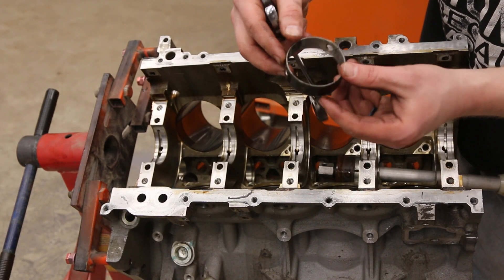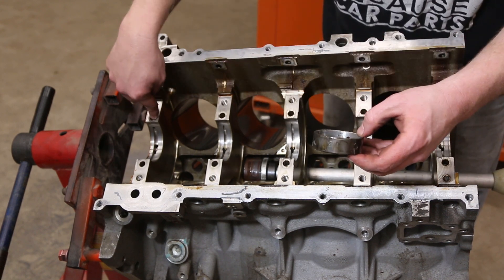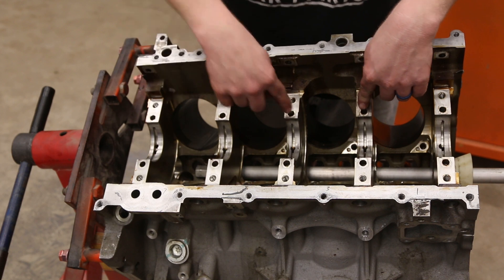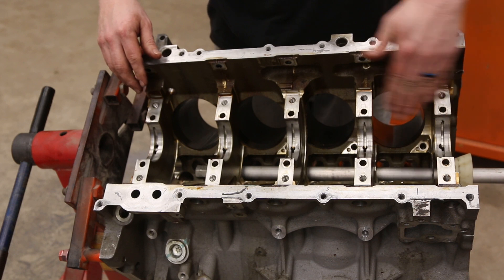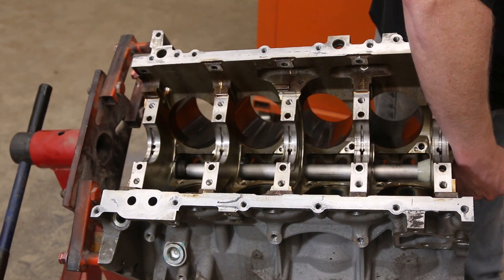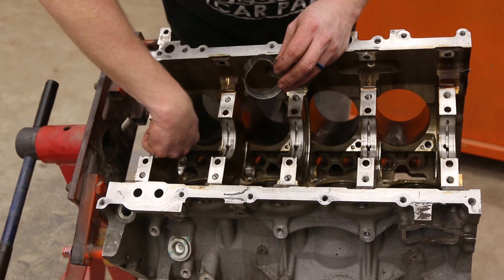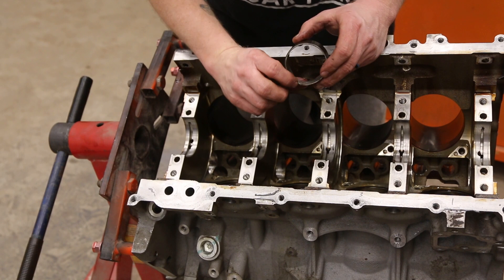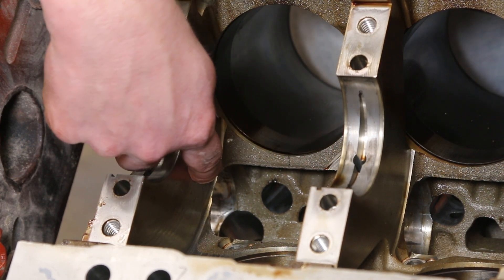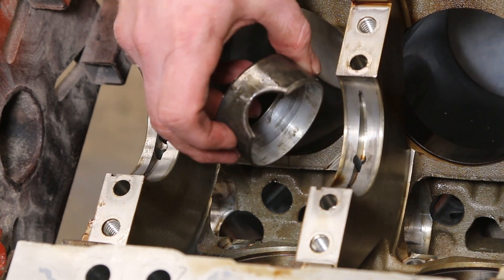That was marked number three — this is your center bearing. The cam bearings are numbered: one, two, three, two, and four — so you have four different types of cam bearings. Cam bearing number five is the rearmost bearing. You'll notice this giant notch, which doesn't leave a lot of bearing surface, but this is a really big piece. In the block we have a big hole that goes through to the valley — that's for the mechanical fuel pump which is driven by the camshaft — that's why this one has this big notch.